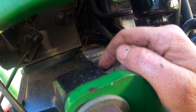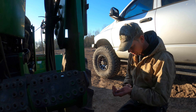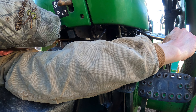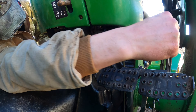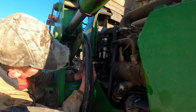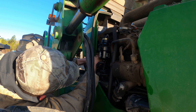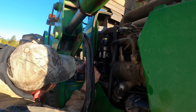Oh, there's the paracord right there - let me go find some needle nose pliers or a hook. That truck is so full of randomness, sometimes it works. Then you want to position these clamps so you can actually get access to them, especially in this case because this thing is going to be buried up tight behind this plastic cover. And this is where we find out the hose size is not 5/16ths - thank you internet. And it's so cold that it's not going to expand well for us.